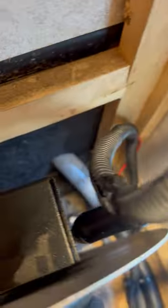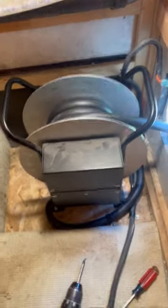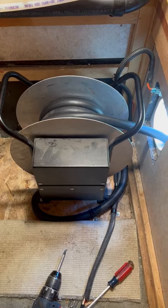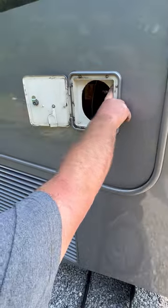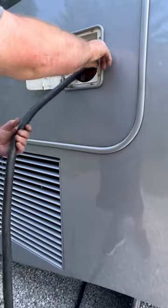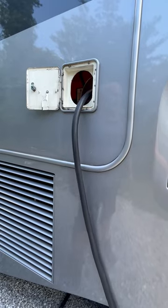I've got all four bolts back in, bolted to the ground, and the wires connected back up and zip tied neatly so no loose wires will hit the reel as it's turning. We're ready to test it out — moment of truth. Let's see if she's going to wind in. And bada-bing, we're good! We can pull it back out — good to go!